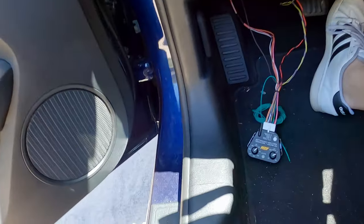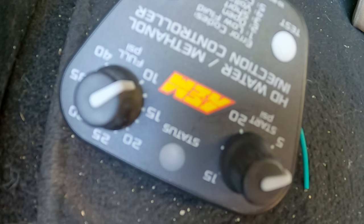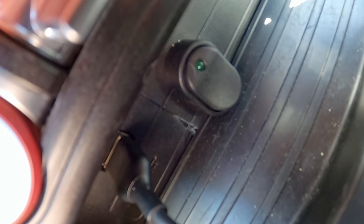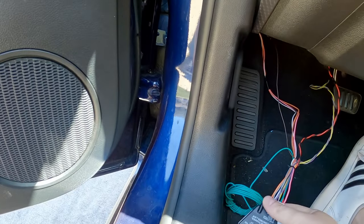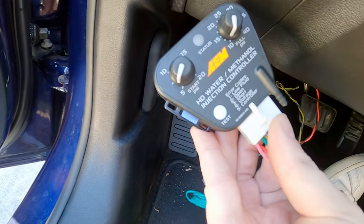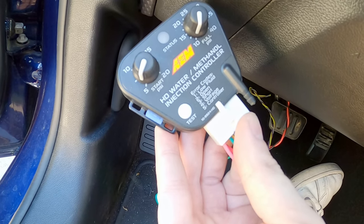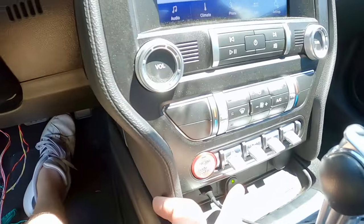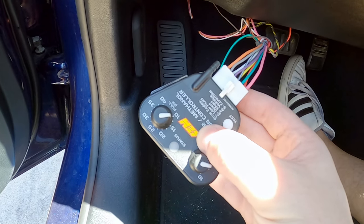We got light, and we got light. Well, there it goes. And you see, one, two. See how it blinks the same code? It's like the old school OBD1 stuff. But that's how you can tell if something's going on. And it tells you right here what they are, which means it's open, because not everything's plugged in. What I want to verify, okay, and if I turn that off, yep, that turns my controller off, thus turning the pump off. Not too bad, not too bad.